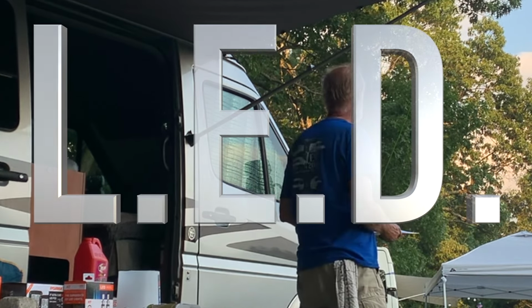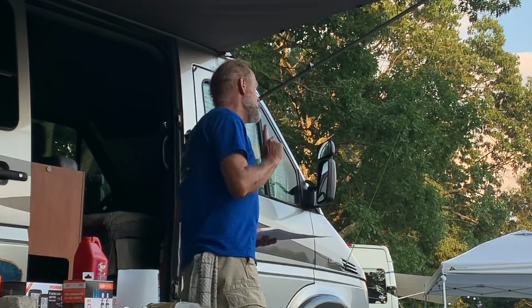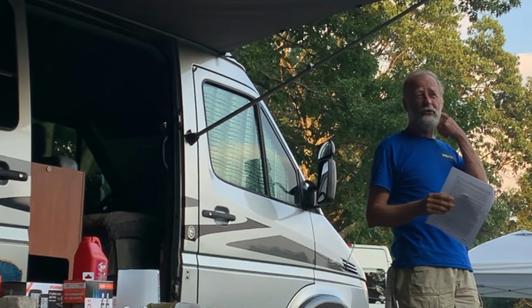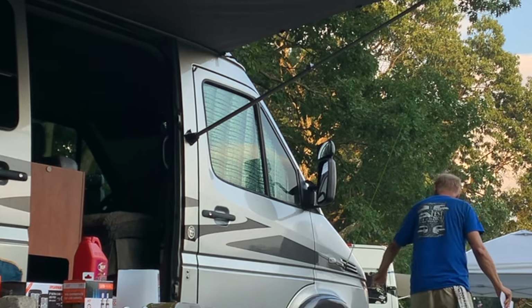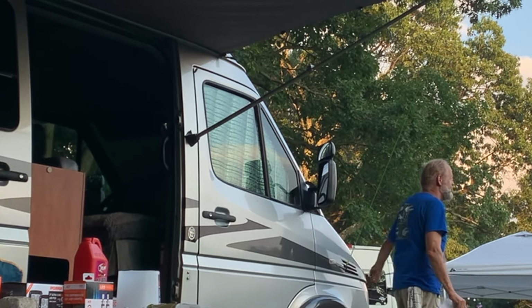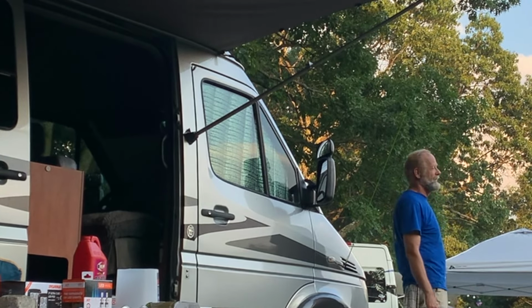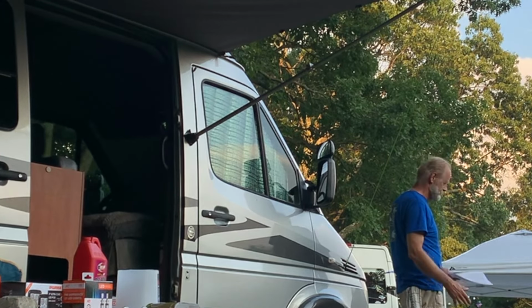Now, how about switching to LED light sources? This gets interesting because I believe there is a solution that will give you optimal performance. It can be done. It cannot be done technically legally. American rules are a little bit outdated. They say if this is an H7 headlamp, in fact the H7 in the low beam and H1 in the high beam, then only an H7 is the legal replacement. And an LED version of the H7 is not an H7, it doesn't meet the same specifications or dimensions.